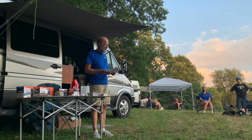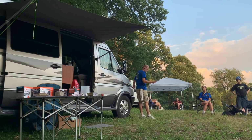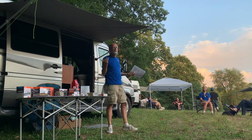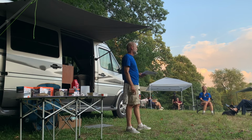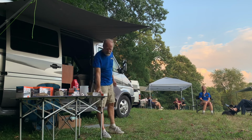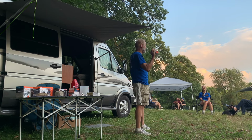Okay. So my key message, what did I do to my own Sprinter? I made sure the headlights were clean. I put in the LED. And I have good light. What you should do on your own van, first, survey the headlights. Try the ATF trick. Invest $20 and an hour of your time. After a couple of years, they begin to look a little sad again. You can get the headlamp kit that only has the cleaning compound and the magic UV block in it.